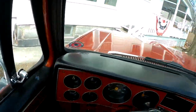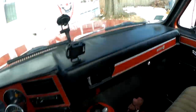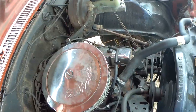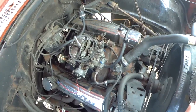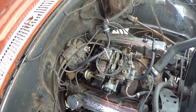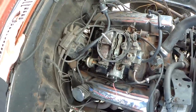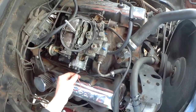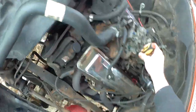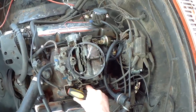That was a pretty successful test drive. New issue though — I press my brake pedal and both indicator lights come on. Literally didn't have this issue last time I drove it. The choke looks like it's actually done its job — it is open. These secondaries here aren't kicking down at all, which I find kind of strange. Maybe it's not really needed — a 305 is not that big of an engine. A Quadrajet can handle a lot more than 5 liters. The problem is I don't really understand the relationship between the fast idle and the idle on this side of the engine.